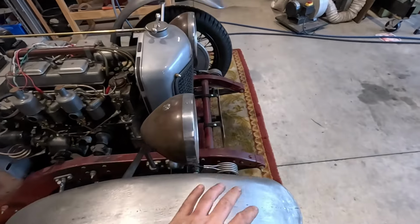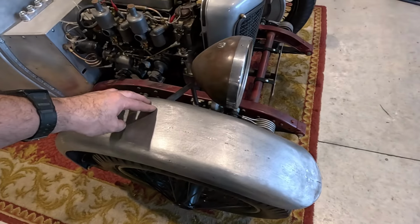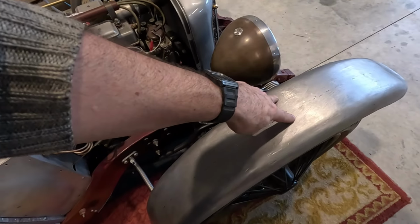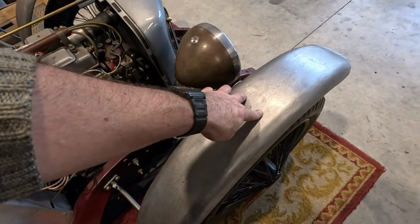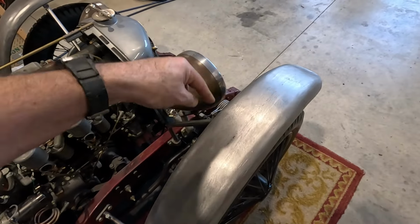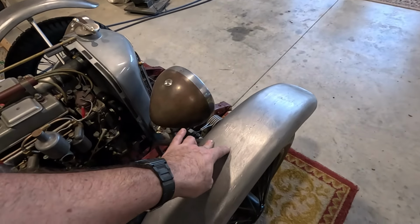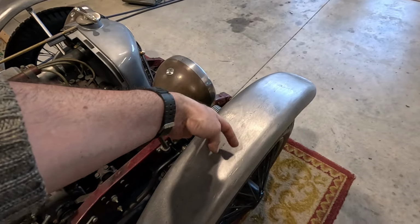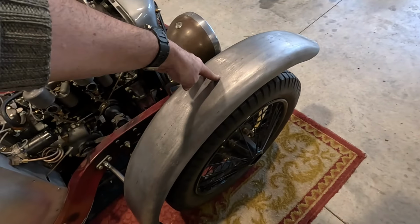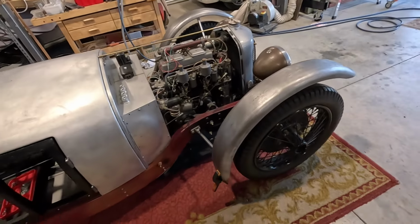And those are there to help stop the fronts flapping around, because there is a bit of overhang here. You can see these still do have a little bit of twist, but once they're bolted on here, so they're not 100% finished, I still need to drill the holes to mount these, and the holes and the brackets need to be filed square because I'm going to use coach bolts with the little square heads, and I'm going to use nylock type nuts on the inside when I do the final assembly. So you can see this has got a little bit of a twist in it, but once that's all bolted down, I think they'll be reasonably rigid, which is good.